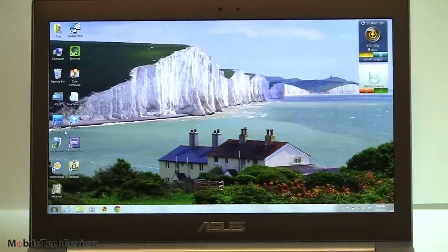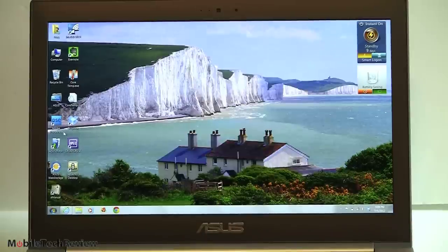Overall, under normal mode the color calibration is pretty reasonable — slightly on the warm side, but in a pleasing way. That's a refreshing change from most notebook displays that are way too cool, making people look a little ghoulish and bluish. This is pretty natural; the grays are neutral. Contrast is extremely high — very nice, very deep blacks. ASUS claims 350 nits; we measured closer to 300 nits, which is still very bright and good for use in bright locations, maybe even outdoors.